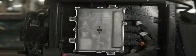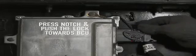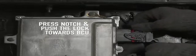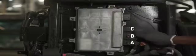BCU. To protect the BCU from damages during bodybuilding, BCU connectors A, B, C and D should be removed. To remove the connectors, first remove D connector. Press the notch and push the lock towards BCU. Remove the connector and wrap it with masking tape. Repeat the same steps for the remaining three C, B and A connectors.